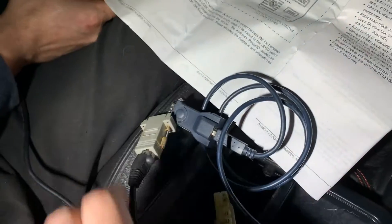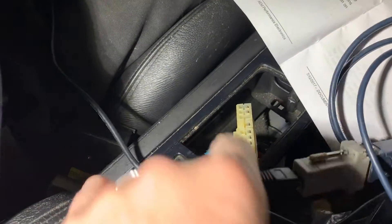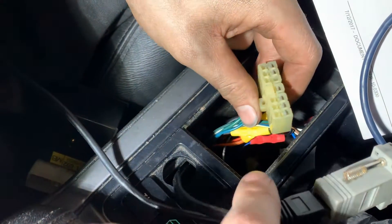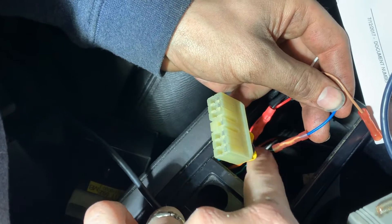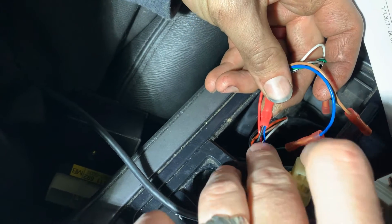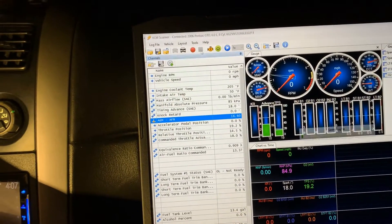As soon as we got that done I plugged it in — Brandon had to plug that in for me. So we plugged that in. You can see this little Ethernet cable; all it did was ring it out to know which wire was which. The green wire on the Ethernet cable goes to our signal from the gauge, and then the blue one gets tied into the ground signal. And then we get our real-time O2 sensor reading. Pretty cool.